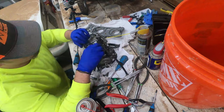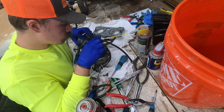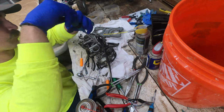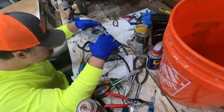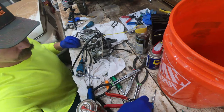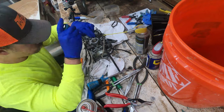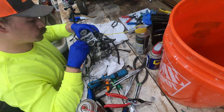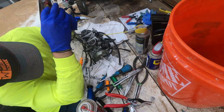These are your carburetor drain lines — they go in here kind of funky. I'm not too worried about these lines because to access the carburetor drain you normally have to take off the radiator, which is a pain. Normally I'll just disconnect the fuel pump and run the motorcycle till it stalls if I'm trying to empty out the carburetor. Otherwise, per the shop manual, you've got to remove the radiator to drain the carb bowls, which is kind of excessive.